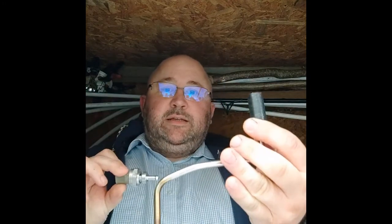In my haste to get the car running again I didn't video how to put it back together, but if you managed to get it out you'll manage to put it back. Putting it back in was much easier — when taking it out I couldn't get my hand on to unscrew it, but on the way in it burrowed in easily. Because it's awkward I didn't use copper slip but I did squirt a bit of three-in-one oil and screwed it in as tight as I could get by hand. Just to recap: the reason I was so desperate to get this out without damaging it was because I'd already been fleeced by the local garage for two to three hours' labour and a sensor I didn't need.